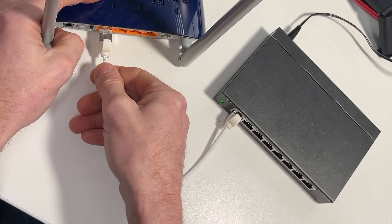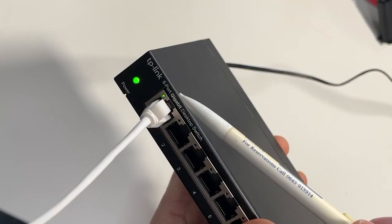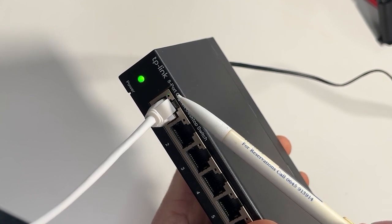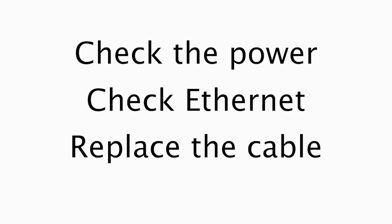Then take out the other end of the ethernet cable and plug it into the switch. When you do this you should see a little LED light next to the port start to blink. This is the link light and it means you have a connection. For gigabit switches the light would normally be green. If you don't see a light, first check both the switch and the router are properly plugged in and powered up. If they look fine then check the ethernet cable, and if you can, try replacing the cable. Your network switch is now available to use and you can plug in any additional cables that you need.